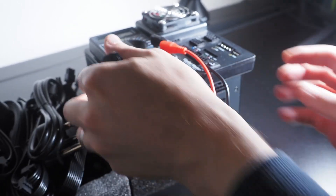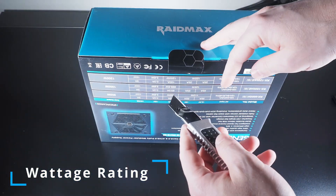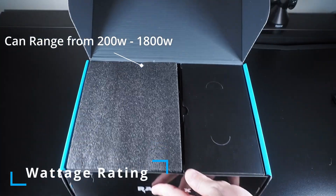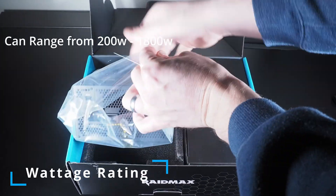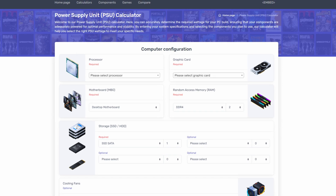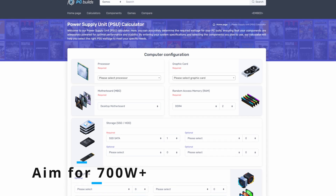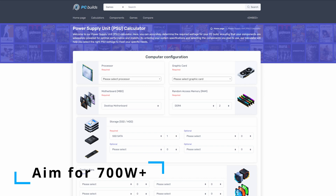There are also three major aspects to break this down, and you actually see a lot of these on the packaging themselves. The first is wattage rating — things like 1,000 watts, 850, 500, 400, 350, even up to 1,800 watts. You need to buy this according to your computer's needs. You should always go a little bit above, so if you calculate all the componentry inside your PC and it needs about 600 watts, you should be aiming for about 700, maybe even 850, if you want to future-proof.